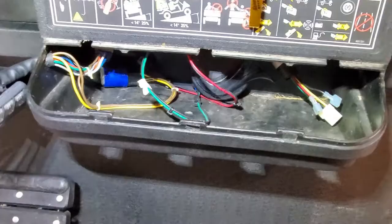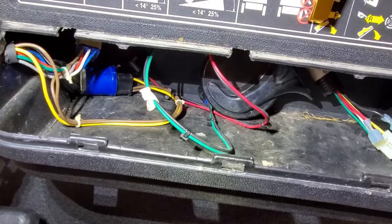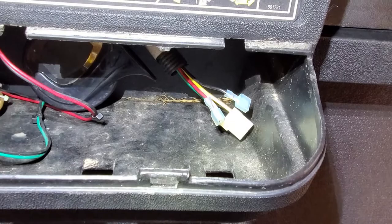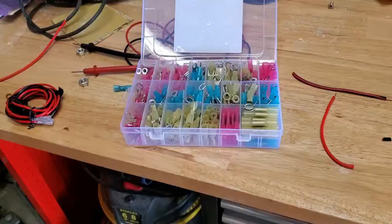This is the area of the cart we're going to be installing everything on. This is the part underneath the cup holders — I just popped those out. We've got some wires under here. I can't find any wiring diagrams online that tell me what they are, but I found that the red and black in the back corner are hot all the time. So that's a direct feed from the battery. I'm going to connect my power distribution panel from there and tuck it in the back underneath, and then it'll give me easy access for everything I want to connect later on.